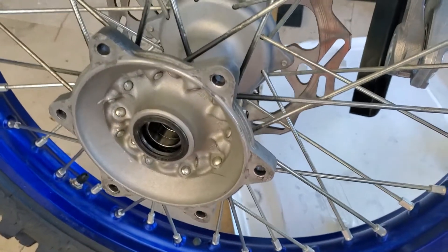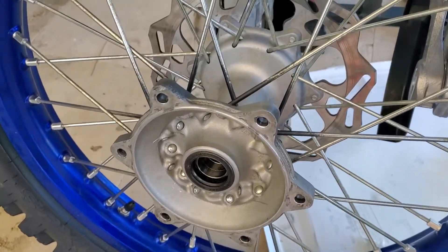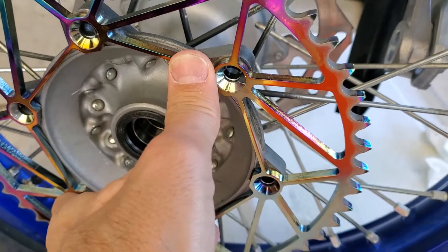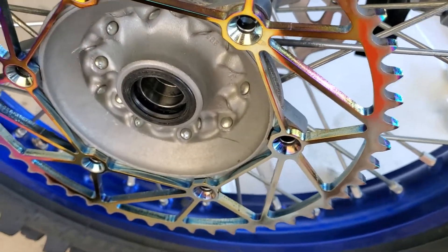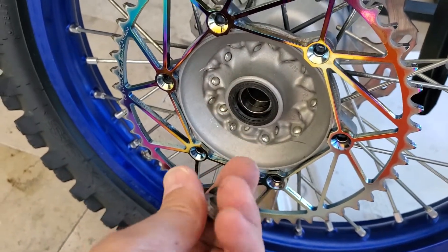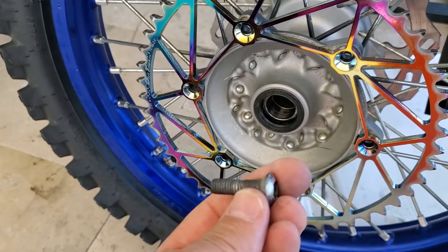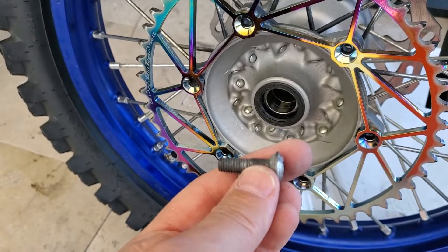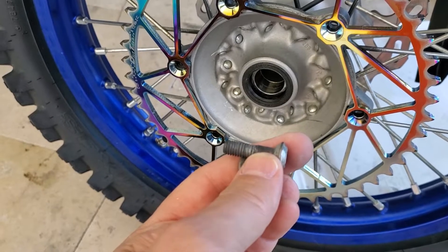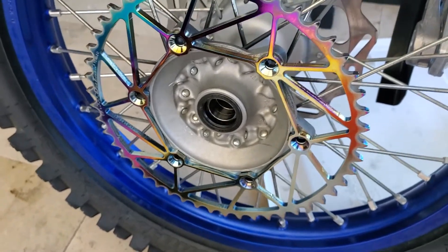I did all this damage in one day of trail riding. Here's what I learned — and you may already know this — but when you put on a new sprocket, I'm never going to reuse my hub bolts again. If you look at the Dirt Tricks website, they have a good video about bolts. They refer to bolts as kind of like mini springs — they have a stretching point to retain tension, and you can overuse them, over-torque them, over-tighten them and lose that springiness.